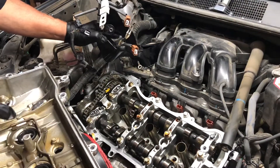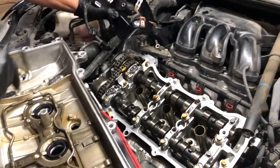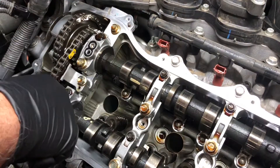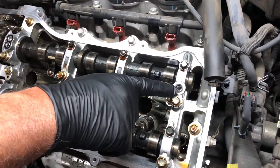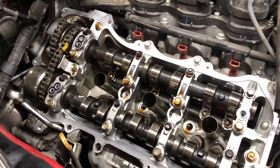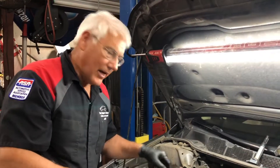But the thing I wanted to show you on this particular one is because the VVT valves are up on the top, there are actually some seals right here. This is a figure-8 o-ring, and then over here we have another one for the breathing system. I want to point that out as today's tech tip because when you order the kit from Toyota or you order the valve cover gasket kit, it does not come with those.